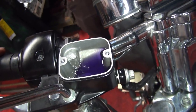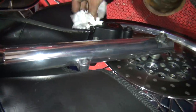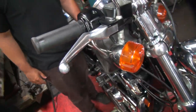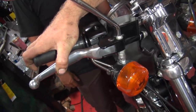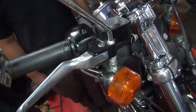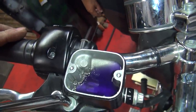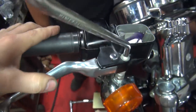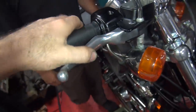A little more air up here. Okay. Nice and clean down there now. Now you come up here and put a little pressure — just pull the lever slowly, not fast. A little faster than that, twice as fast. See, notice how it got kind of tight right there? That's because there's no air in it. See more air coming up? See how you see his bubble coming up? Fluid transfer. Now, if I go real fast it'll squirt about six inches. See how you're going about this far — that'll stop you. Yeah, it's solid. There's no air.